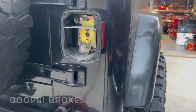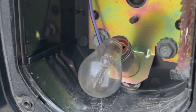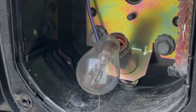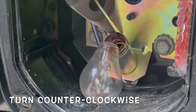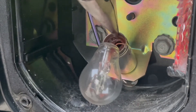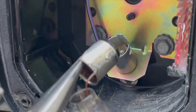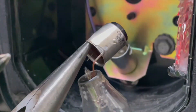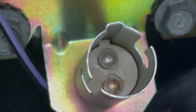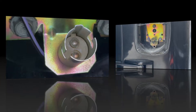I'm going to show you in case this happens to you how to remove it. I'm just going to use some needle nose pliers — remember you're going to have to turn counterclockwise and then pull up. I'm turning it slightly counterclockwise; I'll show you a close-up, then pull up to remove it. This bulb has two little buttons on each side that fit into little slots. When removing it, it's counterclockwise; when installing, you push down and turn clockwise.